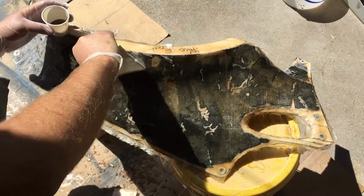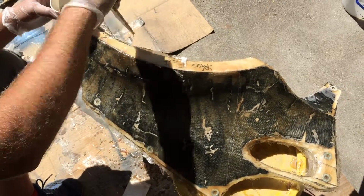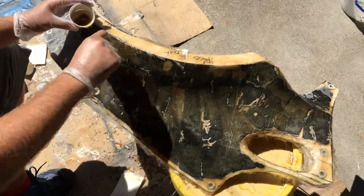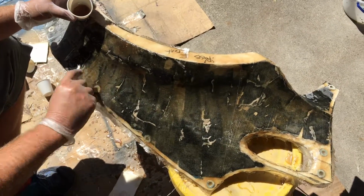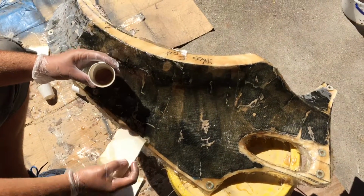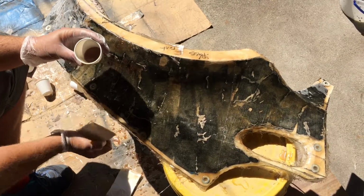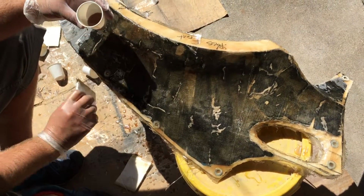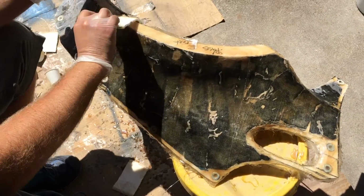Try to pick it up and push it back where we need it. You want all the white visible fabric to be melted together, and you want to overlap that edge a little bit too. You're gonna have to drip a little bit. That's okay. It's kind of just the way it goes because you got to saturate that edge. You want it to pull around the corner. I'm not wrapping it underneath, but I want it to get as much of that corner as I can with it, and then I'm gonna sand it off once it's set up.